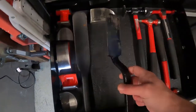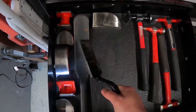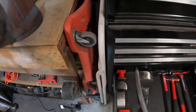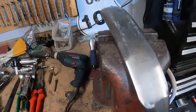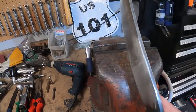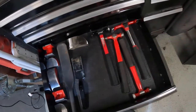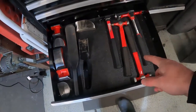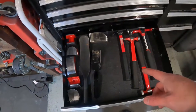This spoon came with the door skinning set — great for slapping steel or getting into a hard-to-reach spot, and useful for an oil-can effect on a panel where you need to slap it out and put tension back into the metal. I've also got a heavier hammer by Martin — about four pounds — really good for stretching long panels like hoods or door skins. That was about $40 to $60. Sometimes you just need to spend $20 and get a basic set; other times you need a more specific tool.